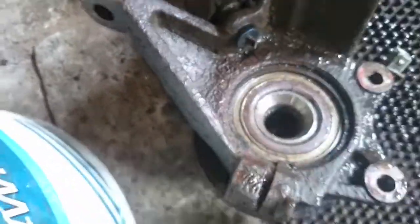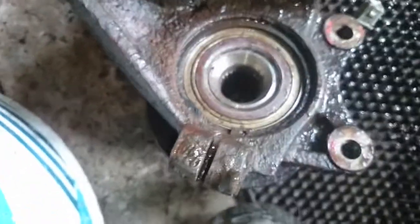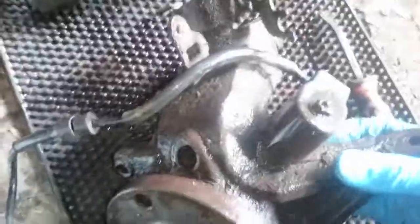That's good news. Now I'm set up I can keep reusing this - you probably want to renew the water and solution every now and again, more because of the filth. I've got a hub here. It's not the rustiest I've ever seen, but it's not exactly nice either. The bearings I have no knowledge of so I'm going to replace those, but I'm just going to dunk it all in and see what it's like. I painted the ones on my car - rubbed them down carefully and painted them - and now after about a year they're starting to look scabby again, but I didn't do this process first. So we'll see what the difference will be.